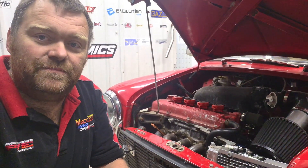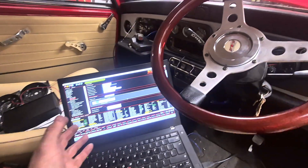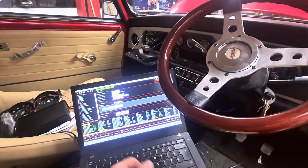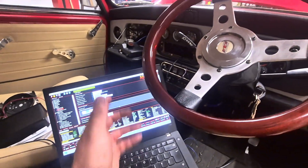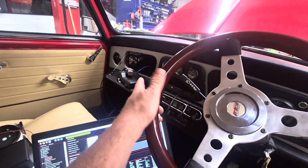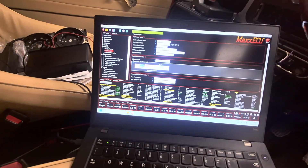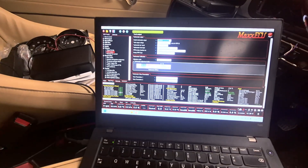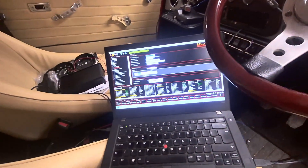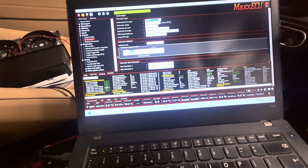The ECU's powered up and it's done a firmware update - it's really common to need a firmware update because Max ECU send out lots of firmware updates, so keep up to date but follow the instructions, including unplugging coils. I usually fit a DT or DTM connector near the ECU for the tacho wire - that's GPO8. I've calibrated the tacho using test mode in the tacho output. I've had to create a little correction table because it's a Chinese tacho and it's significantly out - 3 to 5 percent between 1000 and 2000 RPM, which is not uncommon.